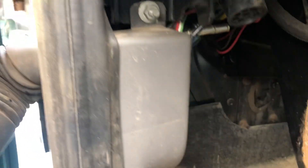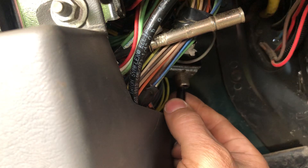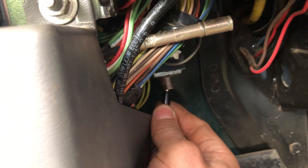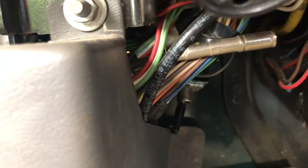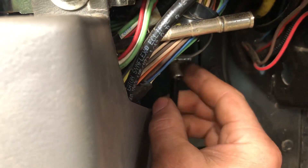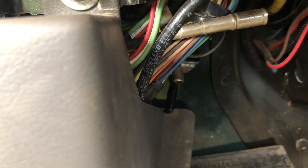I found over here — I don't know if you can clear these with a scan tool — but I found a switch over here. It's a momentary toggle switch. To clear the codes, you will turn the key on and then flip the switch three times like this and it should clear your codes.